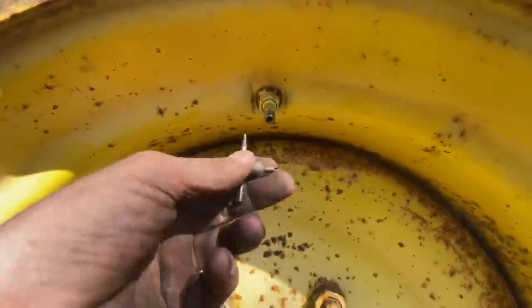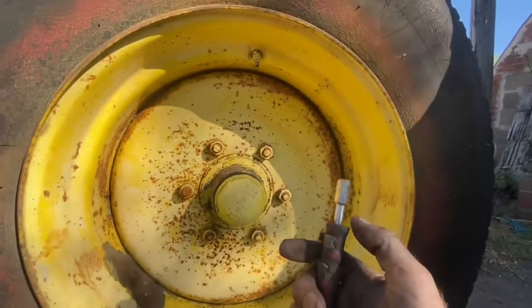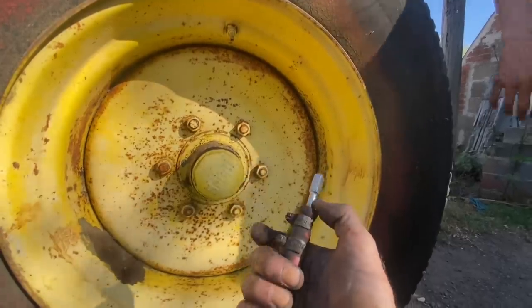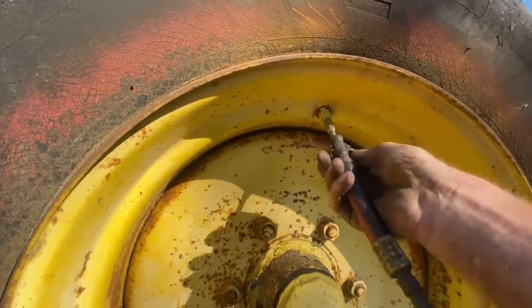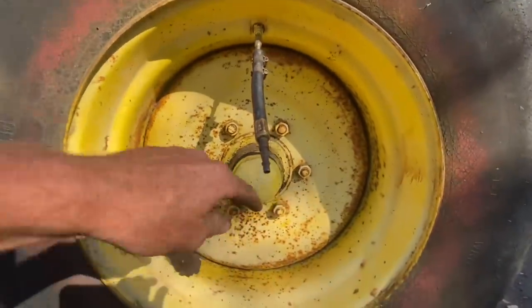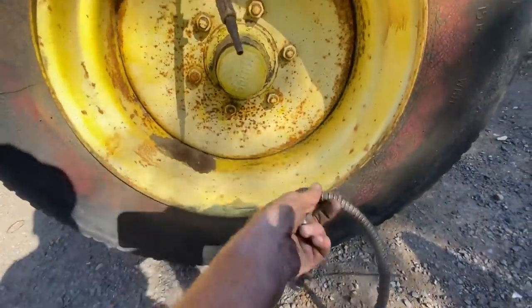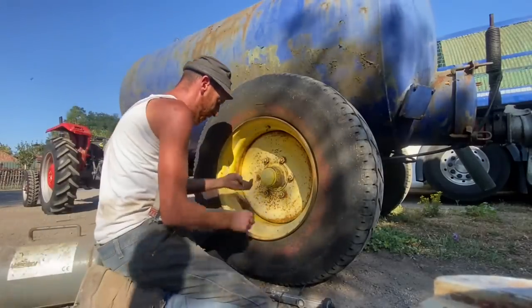What I'm going to do now is take that valve out of there, and I've got that - which is a valve extension what I've chopped down and just put on an airline - and then put that direct into there, and then it's having more air pressure flowing through it. You haven't got it to go through the valve restricting it, and hopefully that should seat the bead.